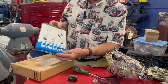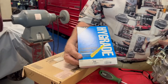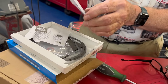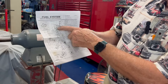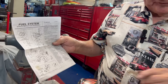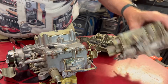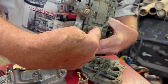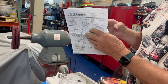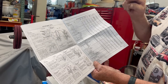This is a really good thing to have even if you don't use all the parts in it — it's a carburetor kit, all the parts you need to rebuild a carburetor. The good thing is it comes with pictures — all mechanics like pictures. It's going to show you how to take that carburetor apart, what goes where, what part looks like what. All you have to do is get the number off of your carburetor. On the Fords there's a little metal tag; on the GMs there is a number on the side. You call the parts store and give them that number off your carburetor, you get a kit, and you get a piece of paper that shows exactly how your carburetor is built, along with all the specifications for setting this carburetor up.